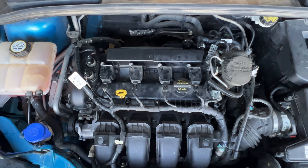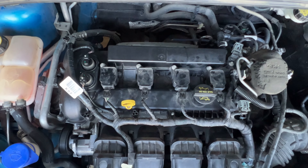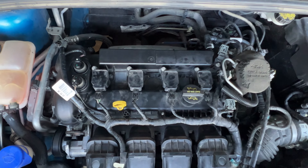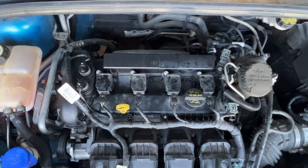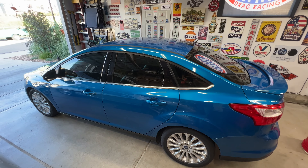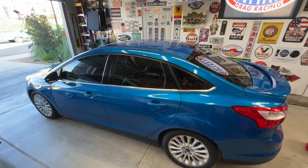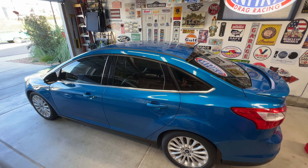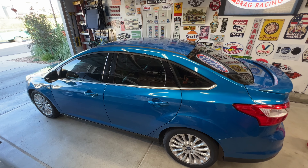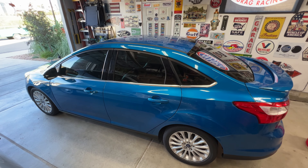That's pretty much all there is to it. I'm going to give that RTV sealant maybe a couple hours to cure before I go ahead and start it just to make sure. Once you let that cure, go ahead and start it, then grab your flashlight and check for any leaks — and that should be all there is to it. So that's going to do it for the video — this was a 2012 Ford Focus, went ahead and replaced the valve cover gasket. The hardest part of this job is getting the old valve cover off past those VVT solenoids because those seals just harden up and as you saw on mine they kind of oxidize and create a little rust there. But once you get them popped off past that, the job is actually pretty easy. Hopefully this video helps you out — if it does, subscribe to my channel and check out all my other videos. I'll see you in the next one, thanks for watching.